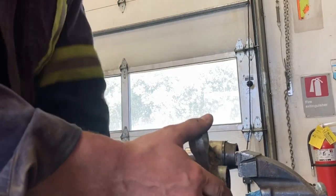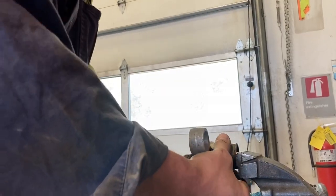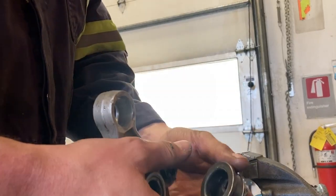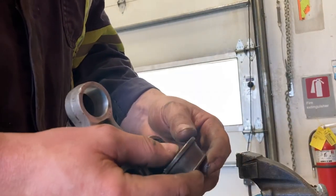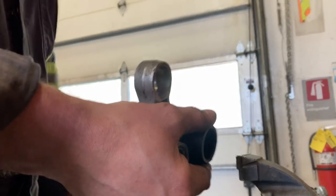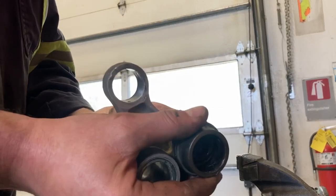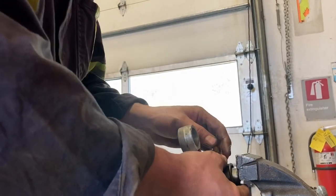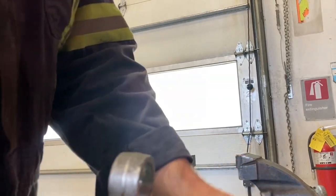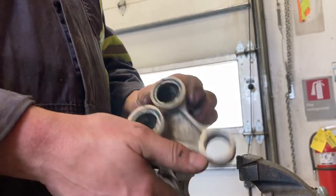As you can see, once they start to move it's pretty easy to just push them right out — just like a U-joint cap, only these probably slide even easier. So there's the inner. I think these ones could have been run still, but they weren't great. These sockets are just the perfect size. If you have a lathe you could always build some push tools, but why bother when you've got something that works as good as these sockets. So there it is — linkage done.